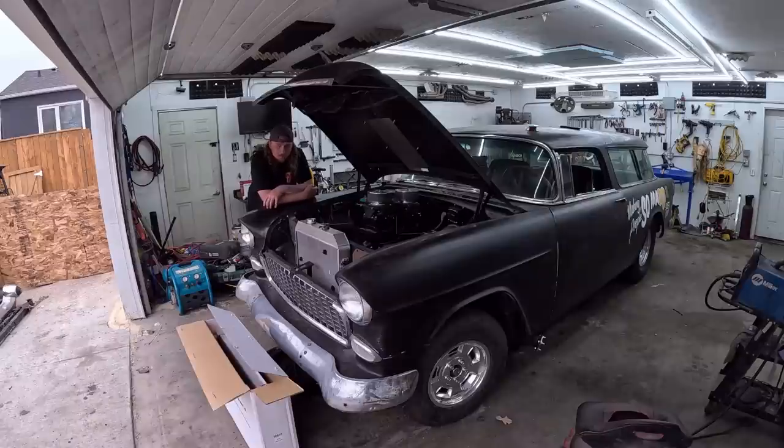I've put it in a couple of different cars with great results. We ran this exact same part number radiator last year down in Atlanta and in Tennessee in crazy heat and stop and go traffic, and it did just fine. I'll probably run it with dual fans, and I'll probably modify these little side pieces so when we're cruising on the highway, all the air goes through the radiator. So we've gotta do that. This rad setup is gonna come out.